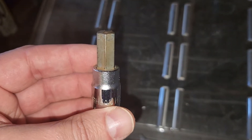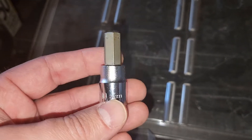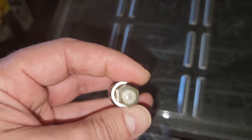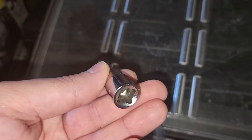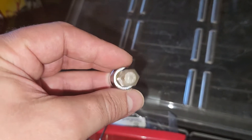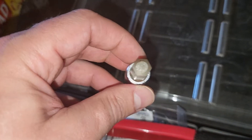Now we're going to go ahead and unbolt the center bolt so we can get the steering wheel out. Just be real careful when you're trying to get it loose, and definitely be careful when putting it back on so it's not over-torqued. The one I was using was a Gearhead brand H10 — one of the thickest Allen wrench sizes you can get, with a bolt onto the wrench. You will definitely need a wrench to loosen that. I'm not a fan of using drills because I like to feel it by hand and get the right torque amounts down.